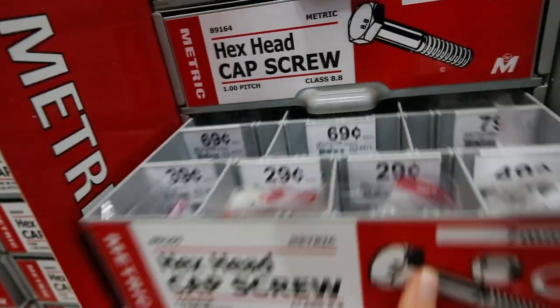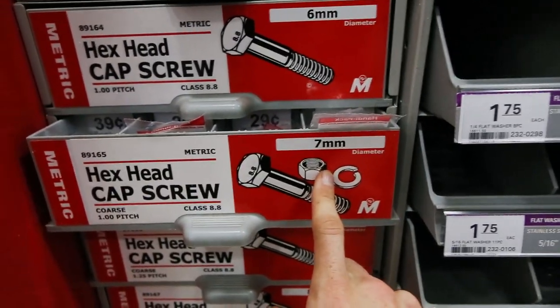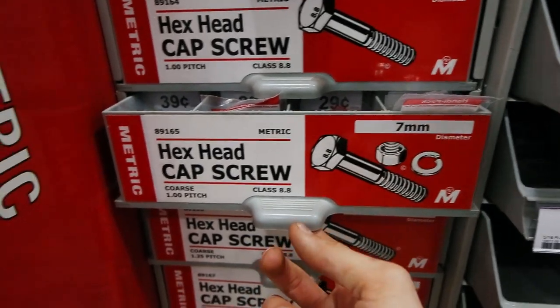All right, we are on day two of this roof rack thing. Heading to Menards right now to go pick up some elevator bolts for the extra holes from the factory rails. We're gonna grab that one bolt for the plus nut that we re-threaded last night. That's that weird metric size. So, should be able to get it all finished up today, get it all siliconed in place, and be ready to rock and roll. Okay, so we're here at Menards, and it is my lucky day, because my thread size was a 7mm by 1.0.